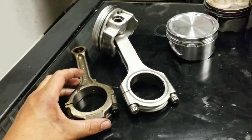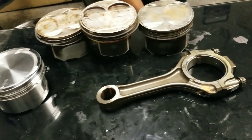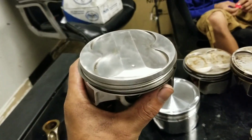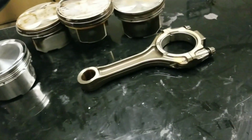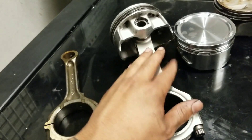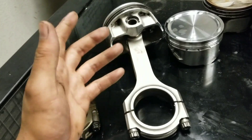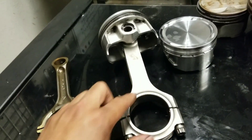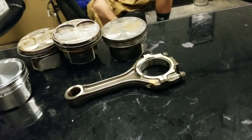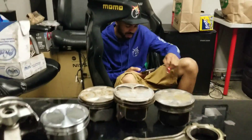So this video is for you guys to understand the difference between HR, DE, VHR, aftermarket pistons, low compression, high compression, NA, or the rods. By the way, the HR Eagle rods look exactly the same as the DE Eagle rods — I posted a video earlier about that. Everything's the same, just the length is a little different and the diameter of this hole is a little different. But everything else is exactly the same. Thank you for watching.